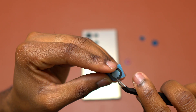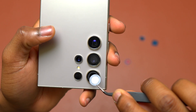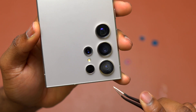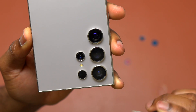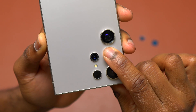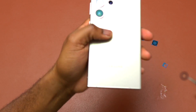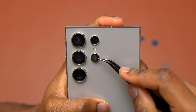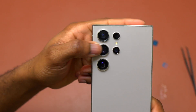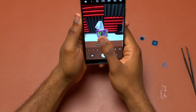The next camera lens is the same as the one I just installed. You just need to remove the camera lens from the blue plastic protecting the double-sided tape, drop the camera lens inside the camera ring where it has to go, and then make sure that everything is aligned and perfectly seated. Apply pressure for the camera lens to stick on the camera bezel. The last one is the smallest camera lens — after you remove it, just drop it inside the camera ring and apply pressure. Now that everything has been installed, you can keep applying pressure for one to two minutes on all the camera lenses you just replaced.